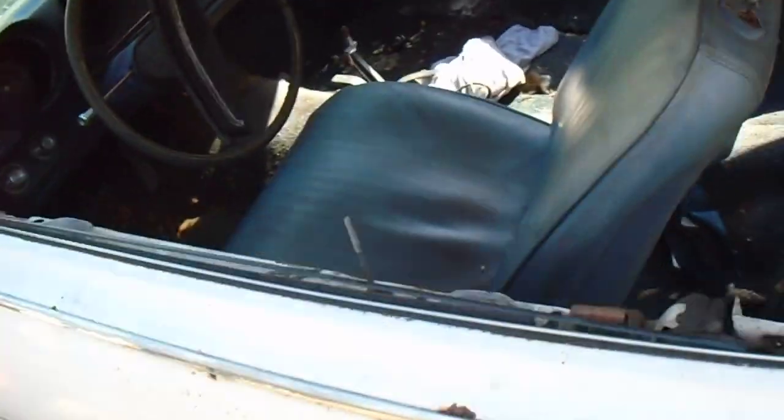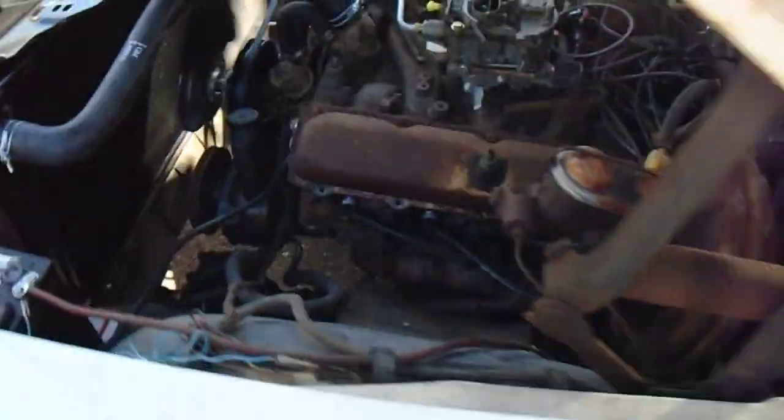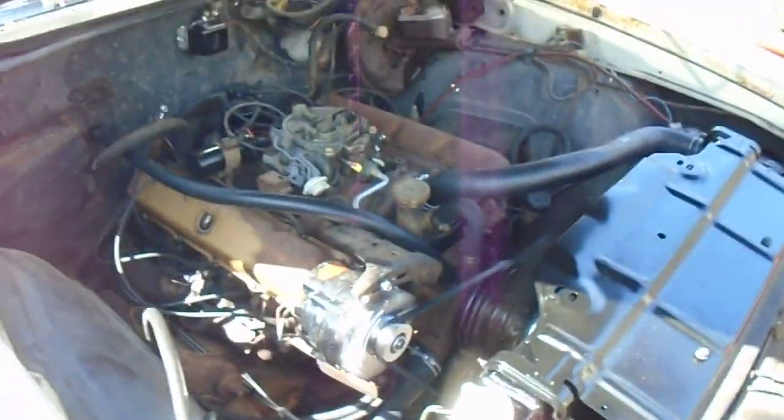Of course it doesn't want to start right away. This thing is still a mess inside; I've got a lot to do on this car. There is an issue with that switch — I think it's a neutral safety switch in that shifter, and that's why it doesn't always want to crank. I got this thing jumped out to the horn relay. But there she is, she's running. I don't think this engine will need a rebuild — 64,000 miles on it. Runs pretty good.